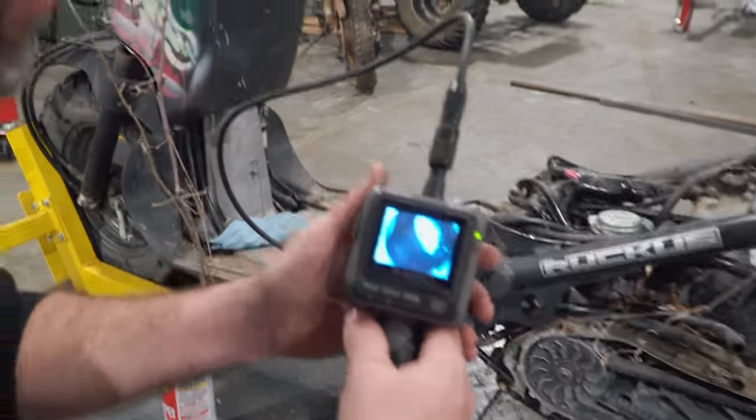All right, so I'm gonna just kind of pry on the valve cover here. Got some movement. It's glued on, of course. Okay. Well, we'll make a new gasket with some RTV if we got to. Yeah. That's no big deal. But it looks just like what we got in the video. I guess that's the timing chain on the cam, right? It's the timing chain, yeah. Okay. Cool. So you gonna try and find TDC?